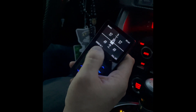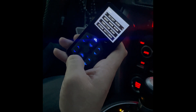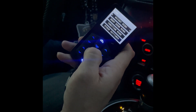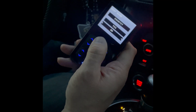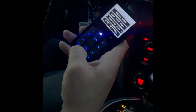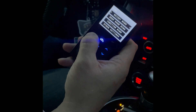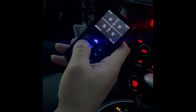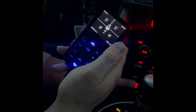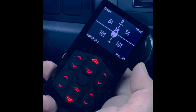To set auto air out, double-click and hold for a few seconds, click the drop-down menu, select 'stall drop,' click the drop-down again, select 'yes,' and execute. That means whenever you shut off the car it will automatically air out. To summarize: select drop-down menu, select 'stall drop,' then activate via drop-down. You'll see 'stall on' is now active. Whenever you shut off the car, you can hear it air out completely.